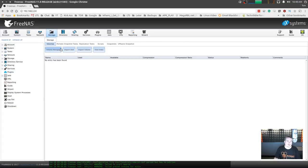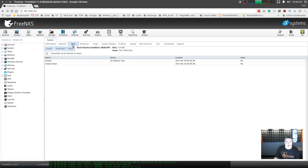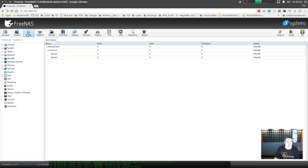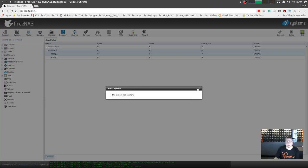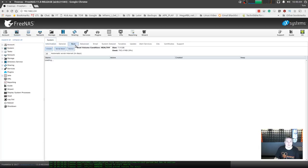So we're here at the storage section. You may notice this is just the way FreeNAS is set up — the new interface makes more sense. You can see your storage, but what you may not notice is you don't see the system volumes there. Those are under System > Boot > Storage. You can see the boot mirror and tell if those are online or healthy, and you'd get an alert if one had failed. This is your multiple USB drive boots.